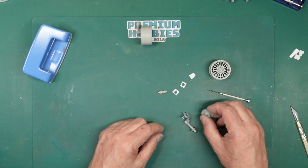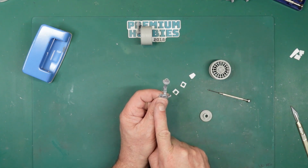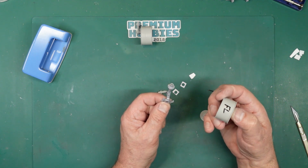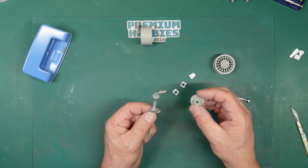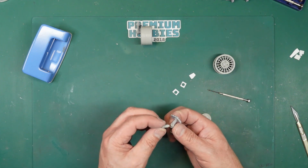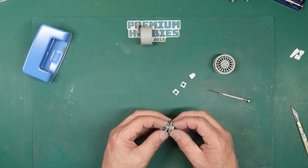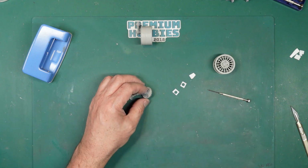And as you can see, the struts obviously have their position on the car. Like that is the front left, because I know the steering arm is at the back. Okay, so I've marked the wheel as such because the wheels may have some difference in the back. The discs I don't need to mark up because of the direction and the spigot diameter, so that can only go on the front left. So there we go. I guess I should mark these up as well. So I'll get these done and then I'll come back and show you how it looks when it's all glued up and everything.